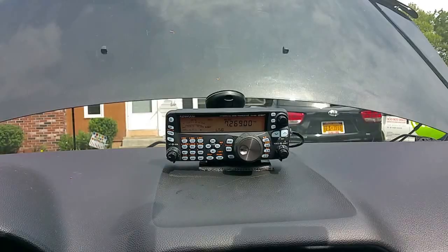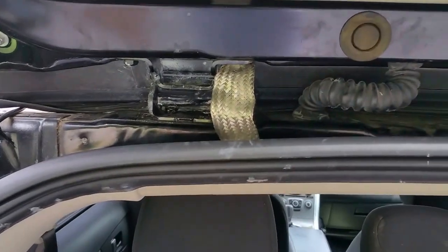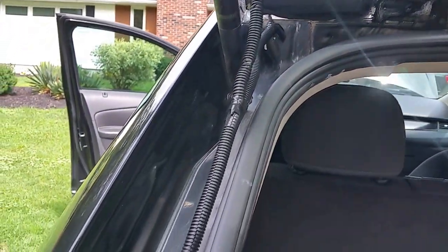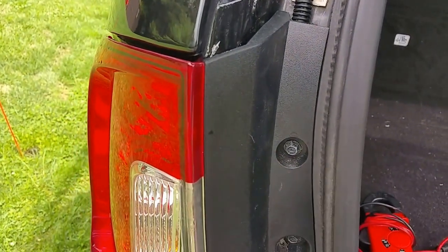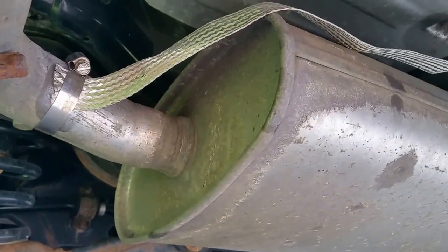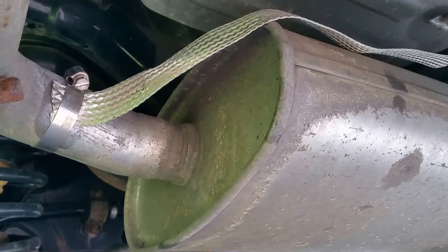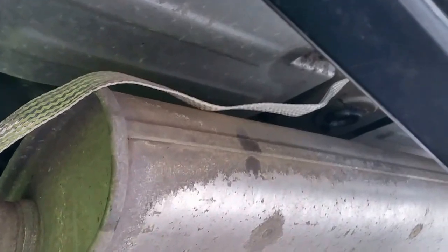Here's the bonding that they want you to do. I have one inch ground strap on each one of the hinges, have it routed, and this lumi cable here goes to the headlight. I do have a drip loop inside the light just so it doesn't drip into the car. I did bond it from the car to the exhaust system — that's another thing that will help bond everything. There is already bonding in the car itself since it's a unibody, but from what they tell me, this does not hurt.